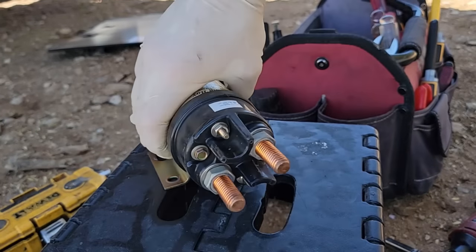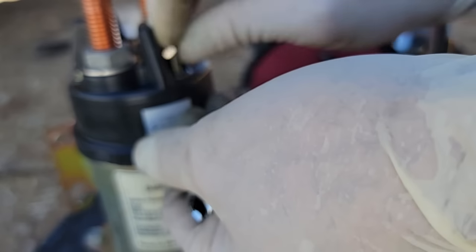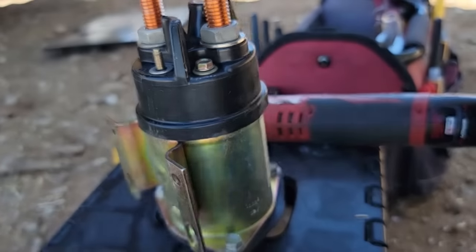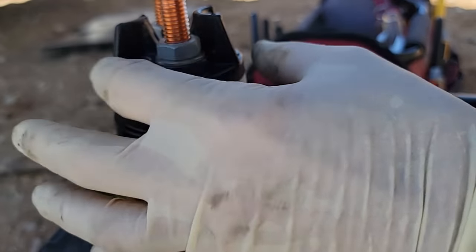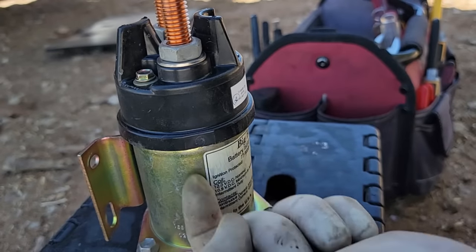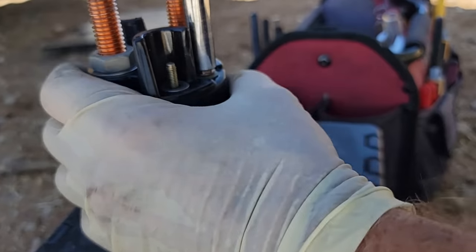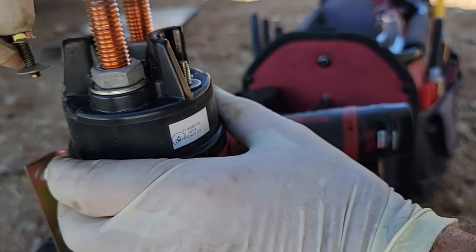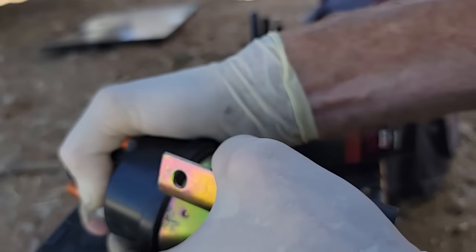So I got it set up here on my workbench. The next thing we're going to do is actually take this thing apart — go ahead and take these off right here. You're going to be hooked up to wires underneath this cap, and I don't want to rip those wires. It shouldn't be too tight — it was just hand-tight on that. I should definitely inspect to make sure that the plastic housing itself isn't cracked or overheated, which I'm not seeing. Let's carefully pull this apart.